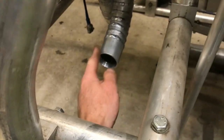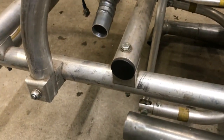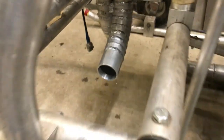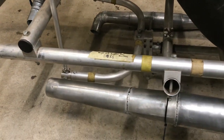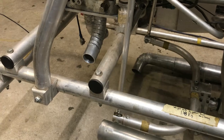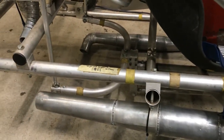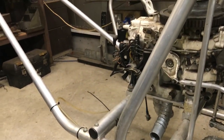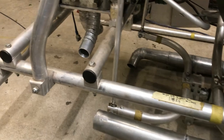Next job is to put the flexible coupling onto that section there. I need 446 mil from the end of that one to the flange, so I need to make sure that stays right. I can move the exhaust forward and backwards to accommodate the correct length. I'm quite happy with it coming forward actually because the CG's a little bit towards the tail — it certainly will be once I've got the radiator and all that stuff on the back. So anything that comes forward is ideal.